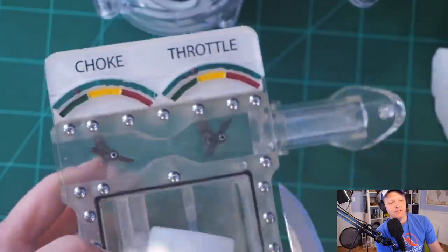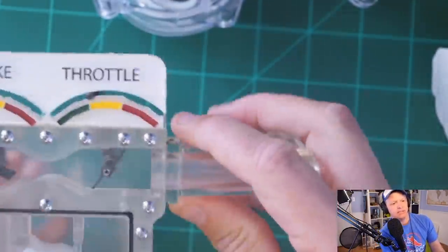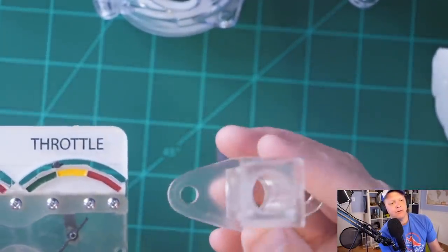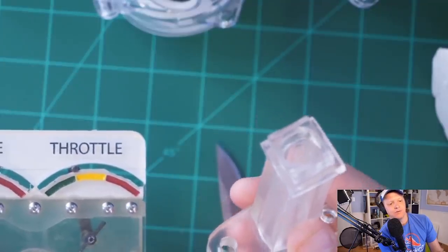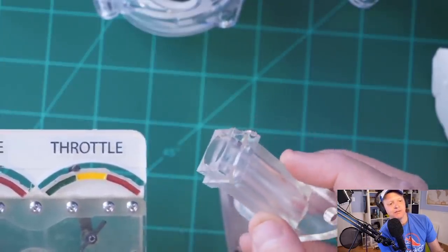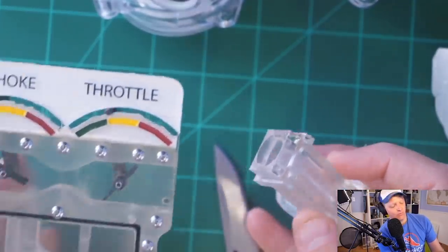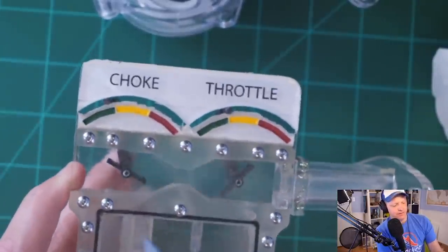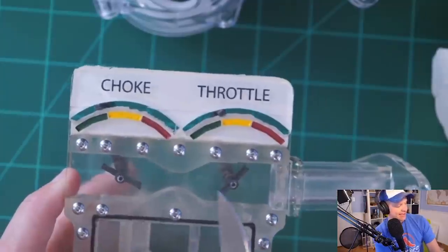But in the slow motion that you see, if you look, this is the intake manifold here. This is just another 3D printed part. You'll notice that it's square. So it's square going down to a circle, and there's a sharp edge there. That's bad. This was a casualty of wanting a flat plate to see through. Trent and I went back and forth on this. I wanted this front plate to be flat.